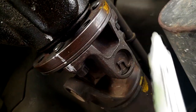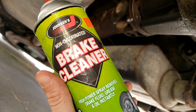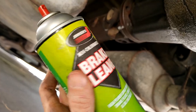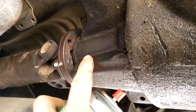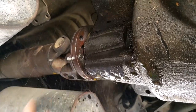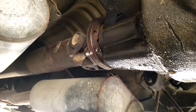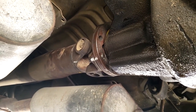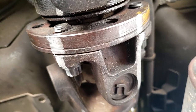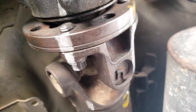Before you lay your marks down on the differential, use a bit of brake cleaner if you've got a bad leak here. That ensures you don't lose your marks later on and also saves your marker pen from getting greasy and ruined. I've done two lines going all the way along, so there's not going to be any problem with orientation.